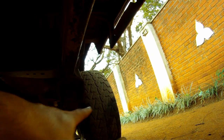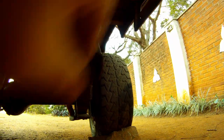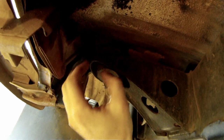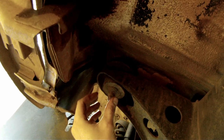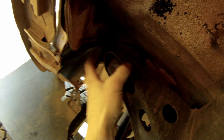There are big brackets on the back here. On the Land Rover the brackets tend to be all outboard and slightly underneath; these ones seem to be centrally mounted in the chassis, which has allowed them to bring the suspension further in under the chassis so the forces are working directly on the chassis rather than having a lever effect on the outer edge. There are also outriggers here, and it's got bushes between the mountings to the body — similar to the Discovery 1 and 2 — whereas the Land Rover is directly bolted to the chassis, which creates massive corrosion between the aluminium body and the chassis itself.